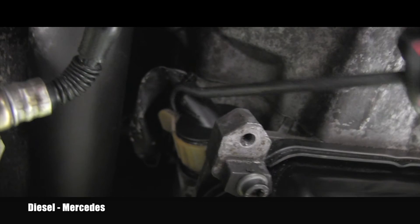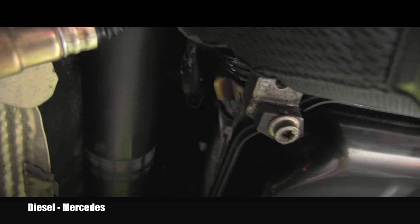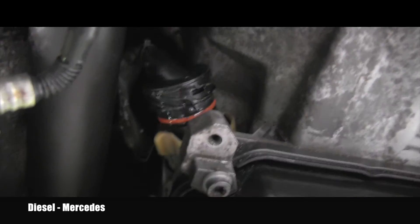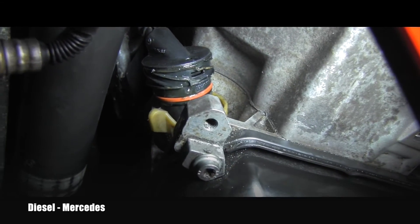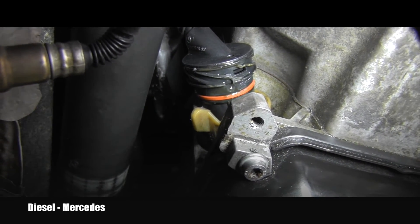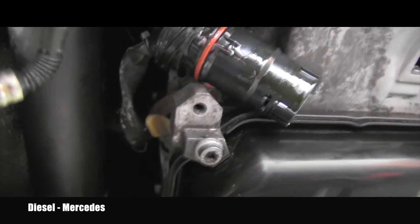I place the hook nicely against the body of the transmission and push against that area. You can see it really nicely gave way and started rotating counterclockwise — you can see how far it goes when you rotate it. Now you're able to pull out the electrical connector. Let me bring the light — you can see it's wet, with a bunch of oil inside. There's no doubt that part of this transmission service will be replacing that connector.